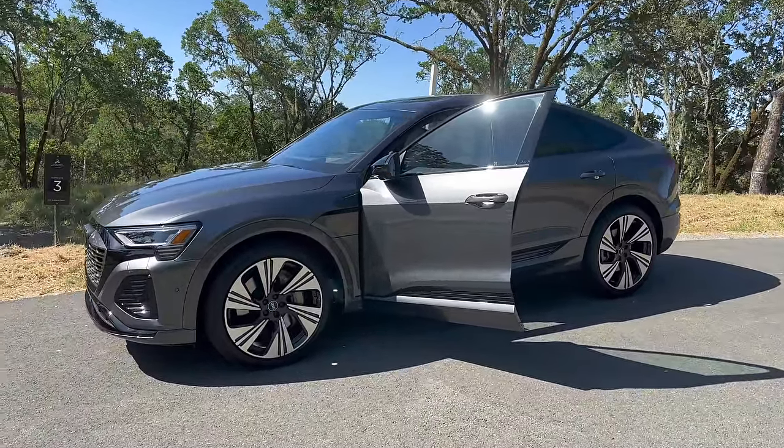And there we are, plugged in, and we are juicing 35 kilowatts. We'll see. It's got to do a little bit more than that, I would think. I would hope. But there we go, 56. Yeah, this car, because it's only a 62.5 kilowatt charger, it's amperage limited. So the e-tron, of course, is asking for more, but that's what the charger can give it. As expected, all is good. We'll charge it up pretty high for the Audi guys, and that'll be that.